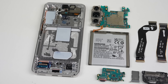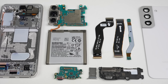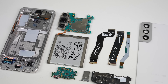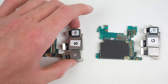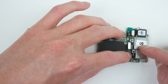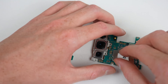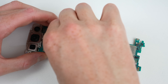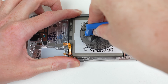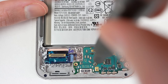We've now fully disassembled the Samsung Galaxy S22. Compared to phones like the iPhone, this is simple to disassemble — significantly fewer components, no security screws, and only two screw lengths. However, the battery is still glued in too hard, just like previous years. Now all that's left is to reassemble the phones. I'll start by swapping the camera modules back onto their original motherboards, then remove any labeling I added to identify each phone before reinstalling the motherboards back into their frames. I reused the original battery adhesive — even after removal it was still too strong to lift with a suction cup, so I'm confident the battery isn't going anywhere.